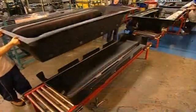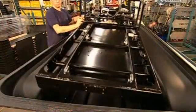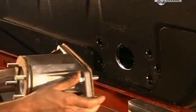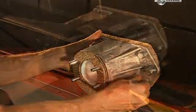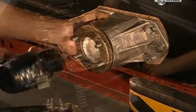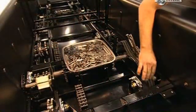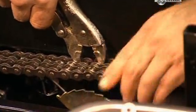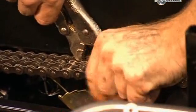Two workers then move the lower body to an assembly line. They insert the vehicle's main frame, now painted black. On the outside, four extensions that will carry the vehicle's two front and two rear axles are added to enable the axles to withstand greater punishment. Eight drive chains are installed onto sprockets on the axle shafts, then two more are added, linking the transmission to the drive system. An end plate is connected to complete the link.